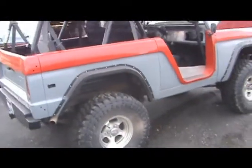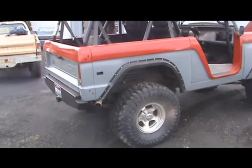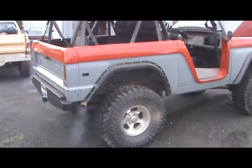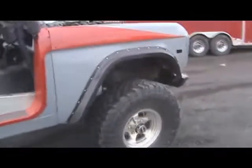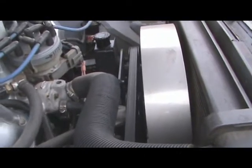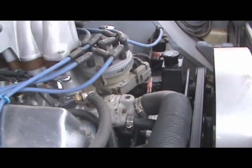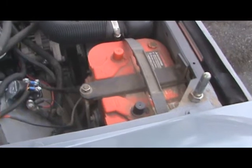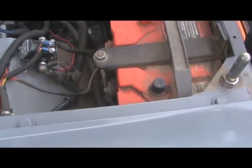That's what it sounds like — I don't know what it's going to sound like on video, but rev it up. And that's not smoke, it's steam. You can see it's a serpentine belt setup with a Saginaw pump and a regular Ford thick-film ignition module, which you have to have for the fuel injection. Optima battery. And we'll take it out for a little road test here and let you hear what it sounds like driving.